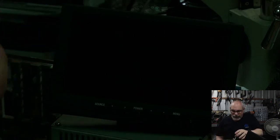That's my mantra. Okay, so I've got a hard drive connected. You can't see it very well because it's so dark, but I have a hard drive connected now, and that should give us the necessary termination. God, look how dirty this cable is. This needs a clean. That should give me the necessary termination that will allow it to boot from my external SCSI to SD. So we'll switch it on again.